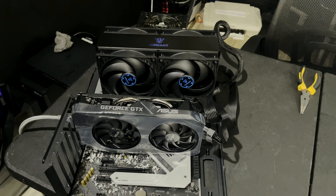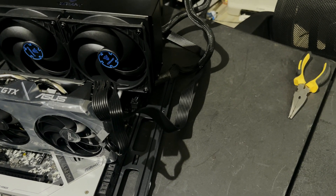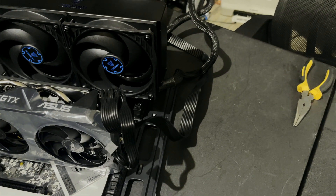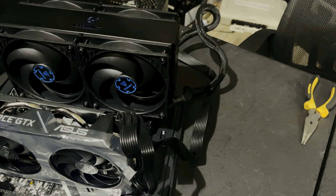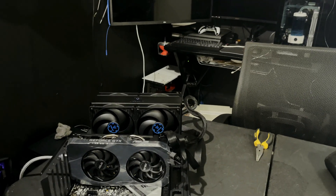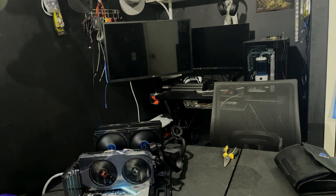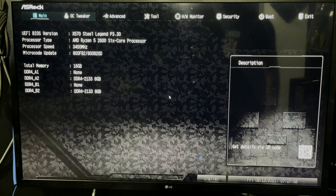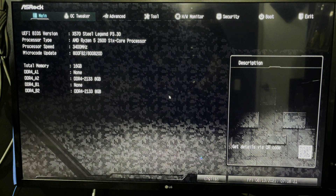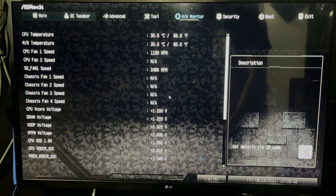The motherboard is completely put together. The 24-pin was really hard to get to underneath this cooler, so if you have a fully modular power supply, put that in before you put the IceGiant in. Any wires your motherboard needs that will get covered by this cooler — connect those before you install the IceGiant. You're going to want to mostly do this outside the case. In the BIOS hardware monitor, our CPU is at 30.5°C — that's 86.9°F. CPU fan speed is showing all four fans reporting together at one RPM value since they're daisy-chained.